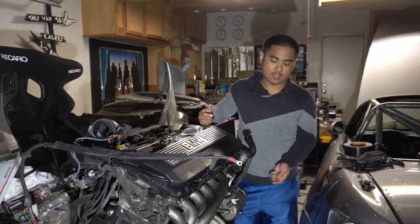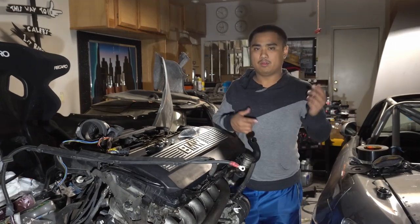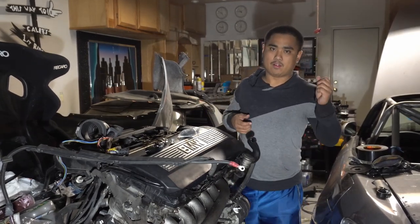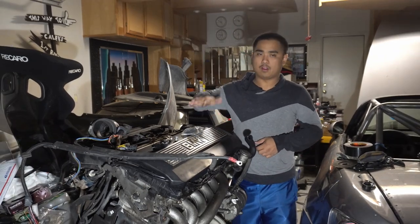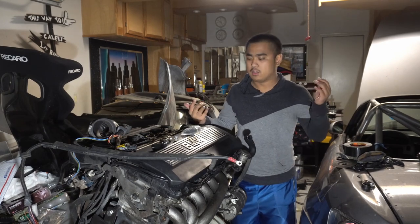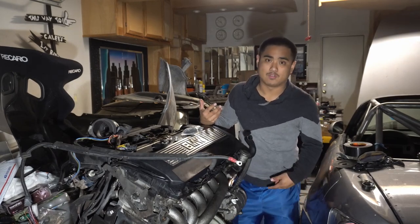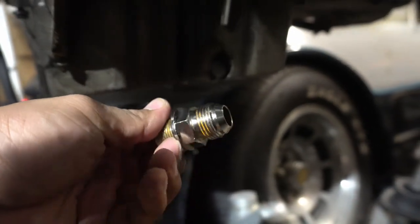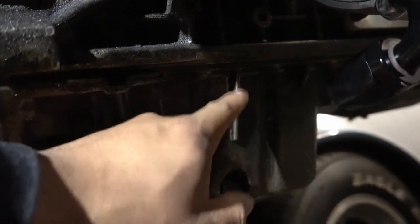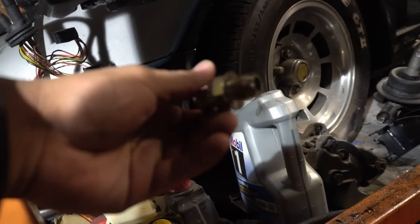There are a couple of issues with this setup, considering how low the turbo sits in relation to the oil level and the way oil drains out of the turbo. Because the turbo sits so low, there's a chance that under left-hand turns oil could slosh to one side and go back up into the turbo. Luckily this is a drift car, not a track car for HPDEs, so I'm going to let that slide. Worst case, if this setup doesn't work or I'm getting smoke from the turbo, I'll probably just add a scavenge pump later. Before I bolt in this oil return bung — which is a bolt-in, not a weld-on solution — I need to grind down this little lip here so the bung has a flat surface to seal on.